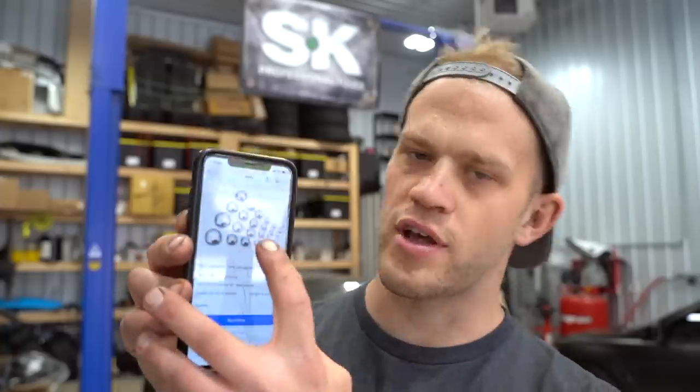This car also has that pretty bad oil leak coming from the turbo oil drain. And I ordered up some of those. Let me just show you guys what they are because I always forget what they're called. But until these things come in, we can't really put a ton of miles on the car. That's what they are. So they go in with the AN fitting, and how I understand it is if you tighten an AN fitting too much, they can start leaking.